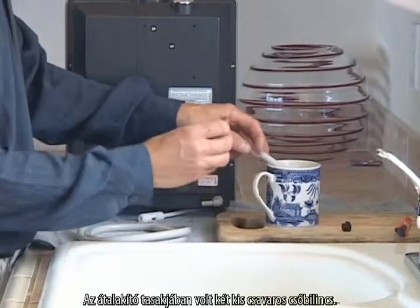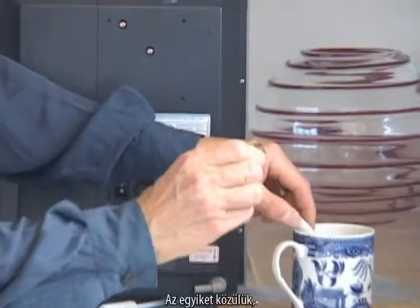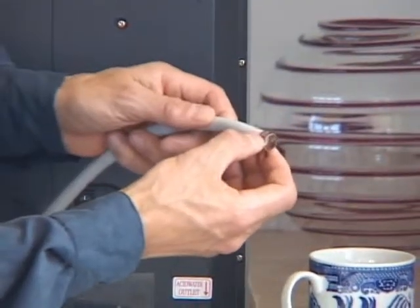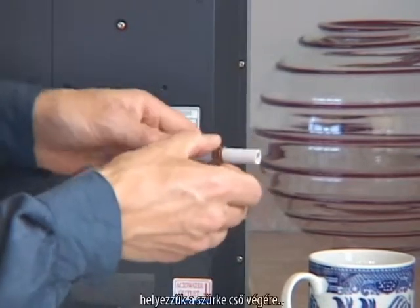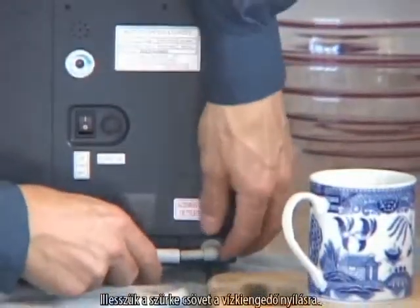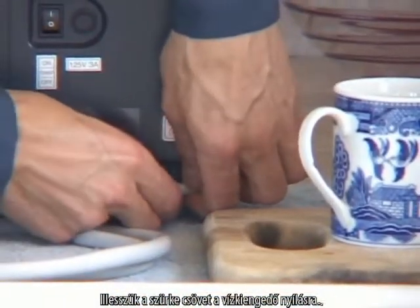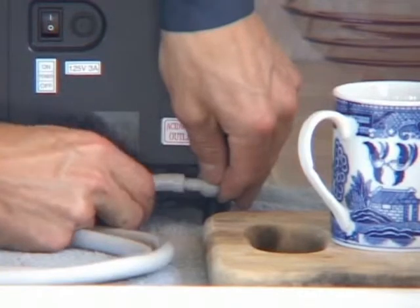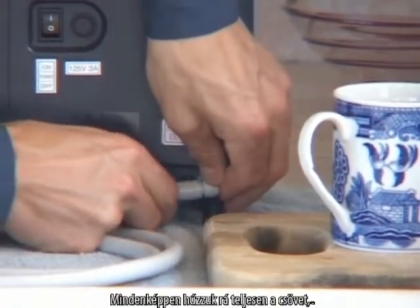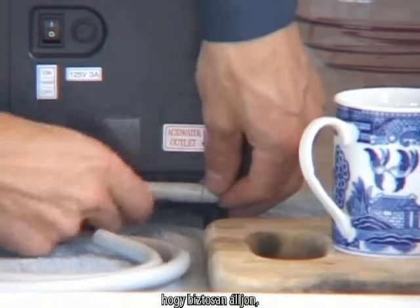In the diverter bag, there were 2 little squeeze clamps. You want to take one of the squeeze clamps after your hose has been soaked and insert it over the end of the gray hose. And the gray hose goes over the acid water outlet port. And that needs to be pushed all the way to the end so that it's firmly seated.